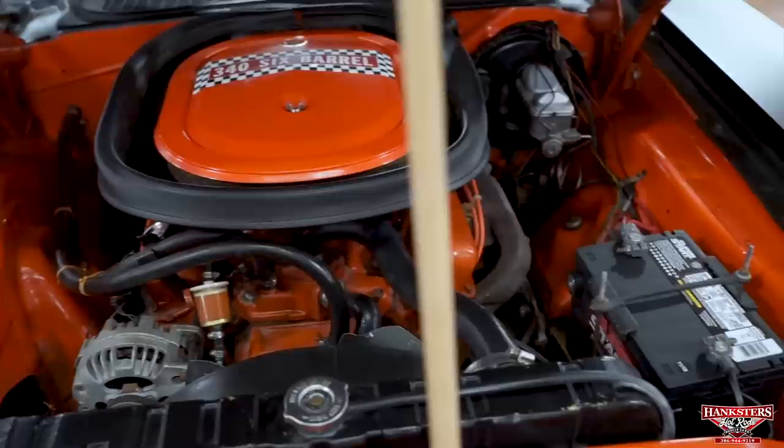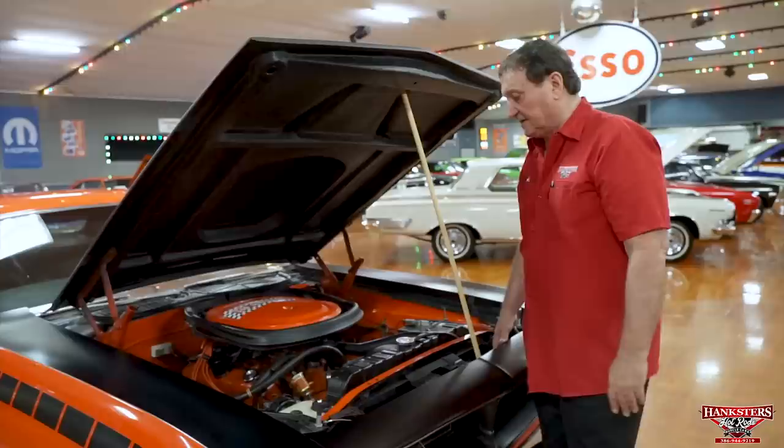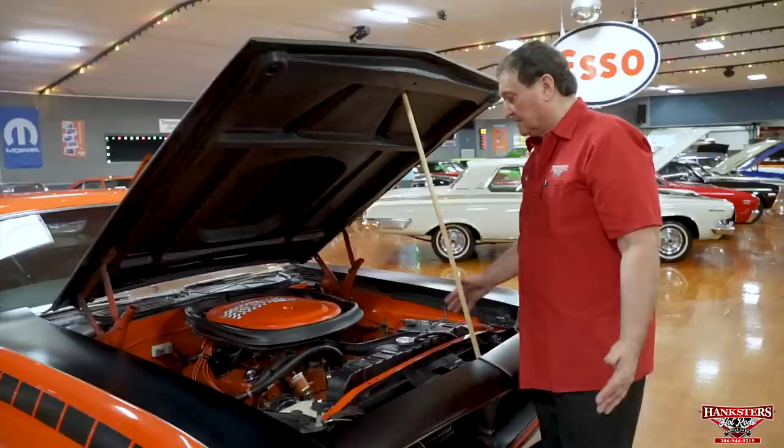The rocker arms on this aren't stamped steel. These are mechanical rocker arms that you can set if you want, instead of just being standard stamped steel ones. The heads have a little bit of an offset for the intake passages. There are just so many things different about this engine to configure it for a race basis engine.